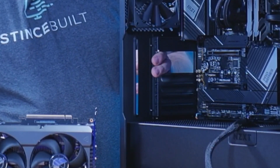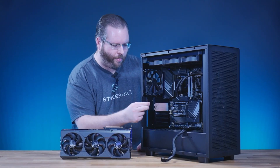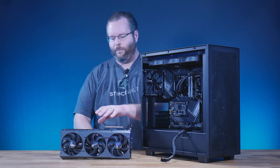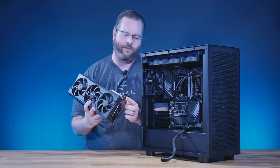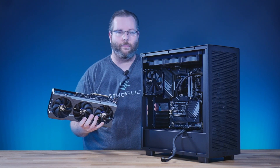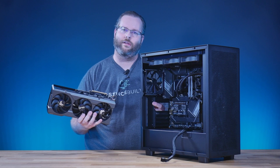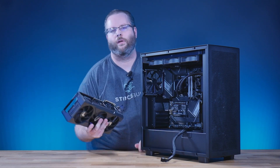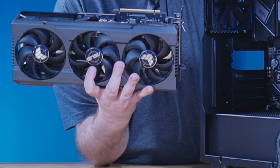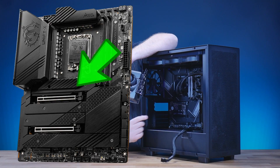The biggest thing you want to do is make sure your slots are clear and your screws are not in place — they come in on your case. We're going to insert the graphics card. You want to align these two surfaces with the back PCI slot expansion slots on the back of your case, which will align with your motherboard. Each of these graphics cards is going to have a PCI slot that connects to the X16 PCI slot on your motherboard.